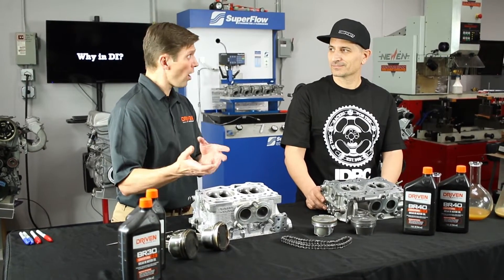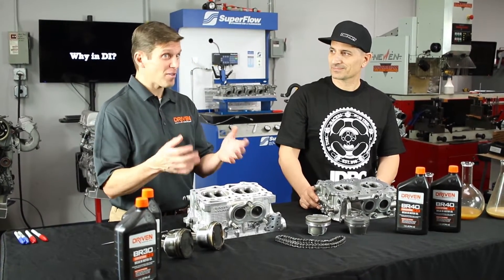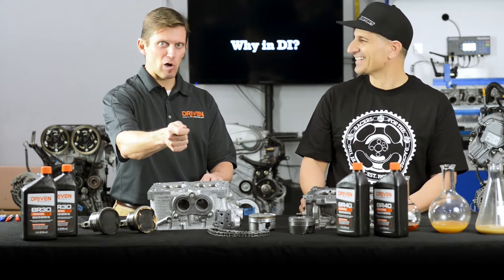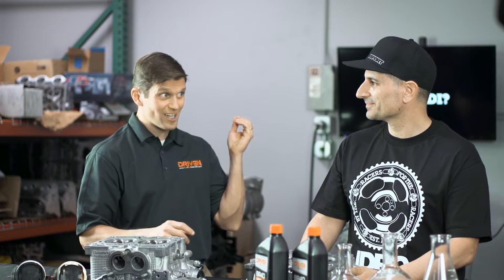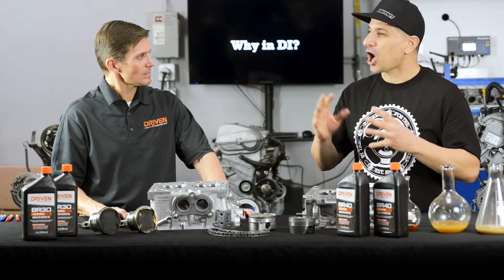You'll never get a full break-in; the engine will probably end up consuming more oil and won't work as well. In my NASCAR days we built 300-plus engines a year. All those engines got the same 20-minute 2,500 RPM initial run, then we'd change the oil and go to 7,000 RPM full load right off the bat. Every engine ran on the dyno harder than it probably would at the racetrack initially. If the engine is built right — tip clearances and tolerances all done right — it's going to be fine. Don't baby the engine.